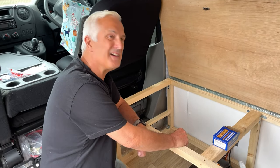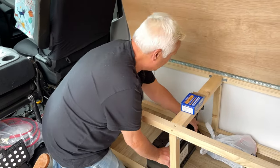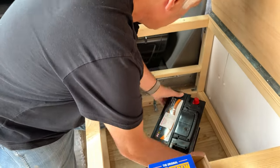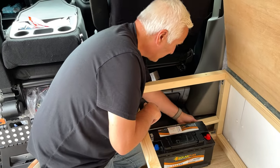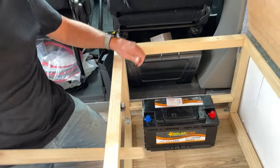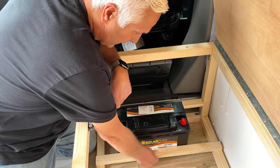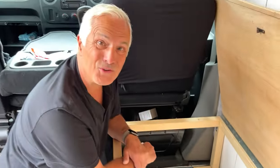It's time to put the leisure battery in. I haven't got the B2B sorted yet, but it's fully charged and it would certainly keep us going for two or three days anyway, because we'd only be watching 12-volt TV and such. I'll have the terminals on this side so it's easier to get at them. I've got a bit of wood, specially cut, which will just fit in there and keep it nice and tight. I've got another bit of wood going on the other side to keep it in place, and I'm going to run a strap over the top as well.